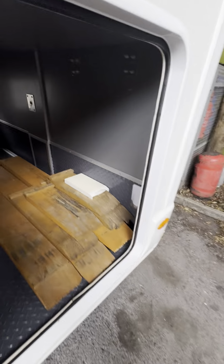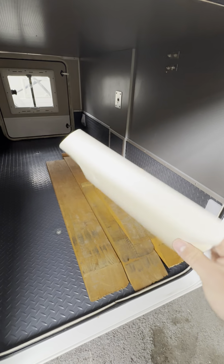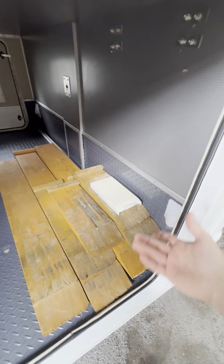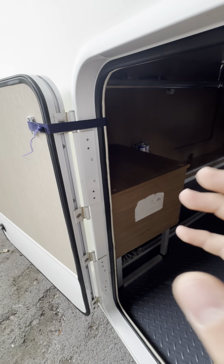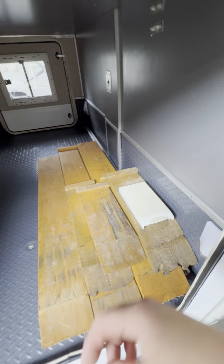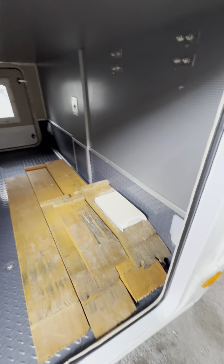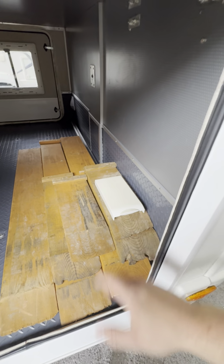There is a cover for that, like a winter cover, which is this thing here. So you need to make sure that this is off before you start trying to light the boiler up, mainly because it just won't work with it. If you imagine that the boiler is going to try and light up, it's going to pump gas through, and because it's not got any oxygen coming into it from the outside with this cover on, it won't light up. But if it does catch, it's going to be a bit of a bang. So just make sure that you take that cover off before you start trying to do anything with the boiler. And once you've taken it off, you can forget about it and do what you like.